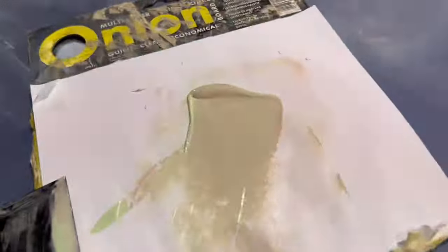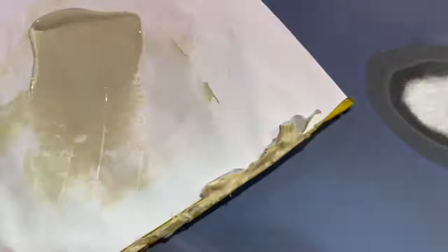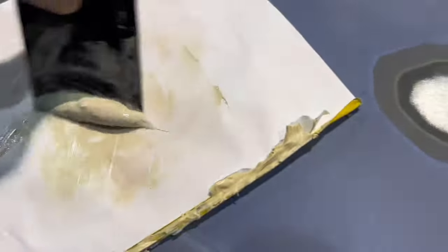So I've checked over the repair and it does feel good, but there is one more wee dent here. You can slightly feel it. I just don't want it to show once it's all painted. So what I've mixed up is some dolphin glaze. It's a thinner filler, sort of a top stop, but it's literally just a wee tiny one there. So we'll put some of that on.